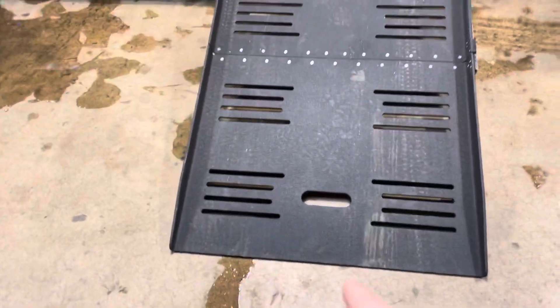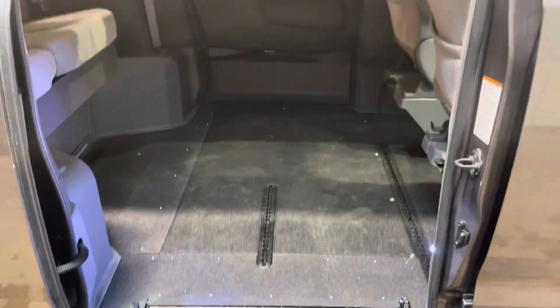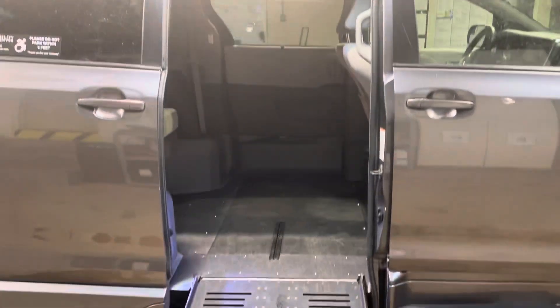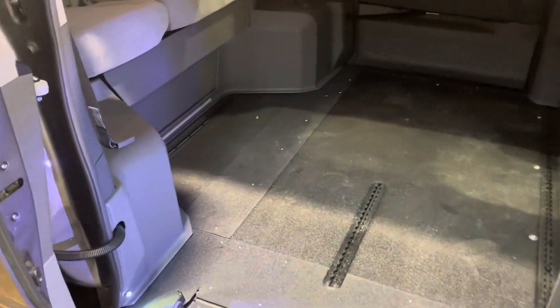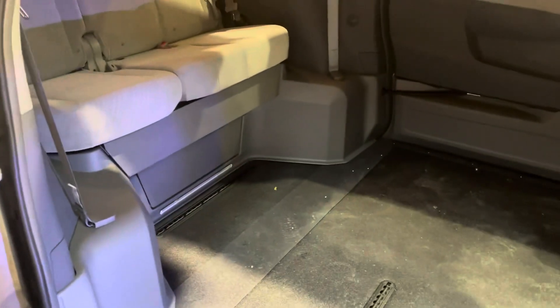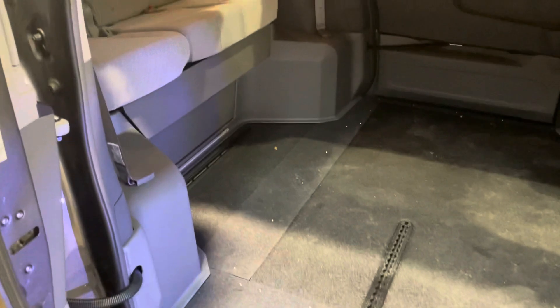So then you're able to come in here. This is a bi-fold ramp — you can see the seam here — 30 inches wide. The door opening here is about 56, 56 and a half inches tall, 32 inches wide. Inside, we've got the AXS 360. They actually have to modify the rear suspension in order to get all that room. As you come in, your feet or your foot plate can actually turn around, and that's why there are undercuts on the front pedestals as well.